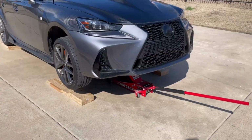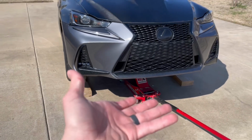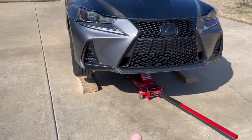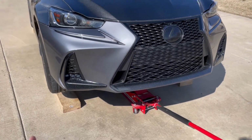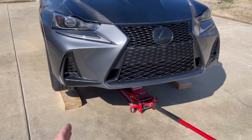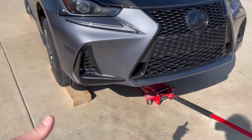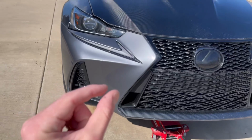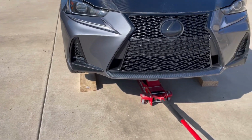bumper. All right, so like I just stated, the next step is to go ahead and put the front lip up against the car, whether you want to use a jack to hold it up or some tape or maybe a box or something, but kind of find a rough space to hold it up against the car. And that's when you're going to use those bigger size holes that you just drilled to go ahead and use a smaller drill bit and drill through them, which pretty much acts as a pilot hole for your self-tapping screws.